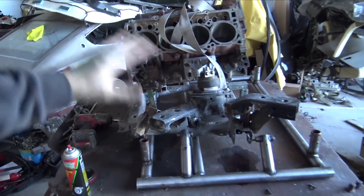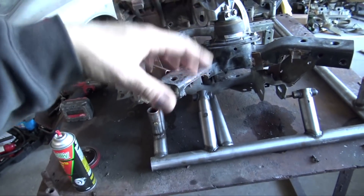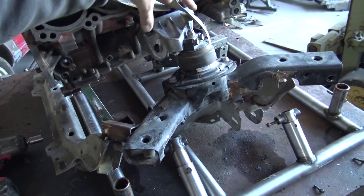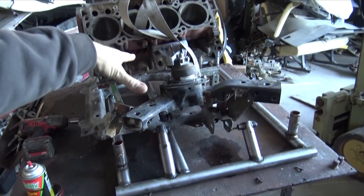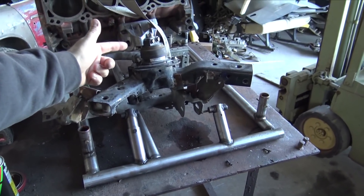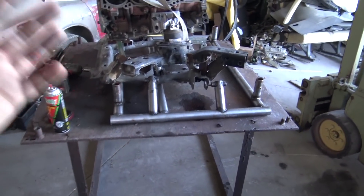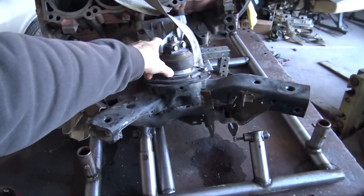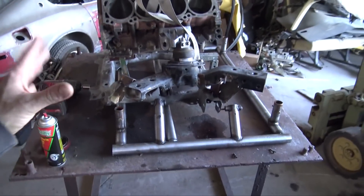Now I have all of this in the correct position. I can remove these engine mounts and I'll probably remove these subframe horns which connect to the frame on the car, and get the locations from the engine mounts to the lower fixture. After that, I can remove all of this stuff, put the upper fixture into it, and translate those mounts up to the upper fixture — because I don't think it'll be a good idea to have the mounts located in the lower fixture, as it'll be really a pain to get the fixture apart that way. The upper fixture will have these locations as well as the engine mount locations, and also this location right here.